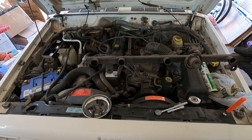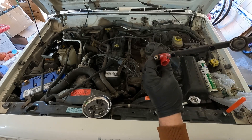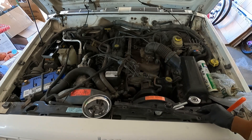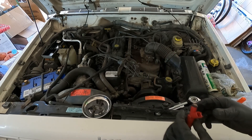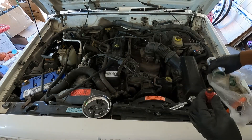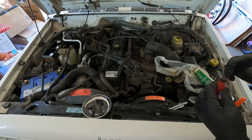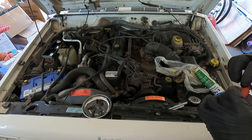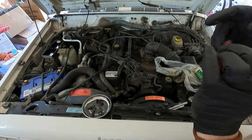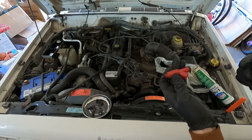I have all of the injectors out. There are two schools of thought: one is put the new injectors in the rail, or put the new injectors in the manifold. I'm going to do them in the intake manifold first. To do that, you want to just get some grease — Vaseline or any type of grease — because if you don't, these o-rings will split very easily. I'm just going to apply it on the injector side. You really don't need much — that's probably still too much. It just helps it slide in much easier.